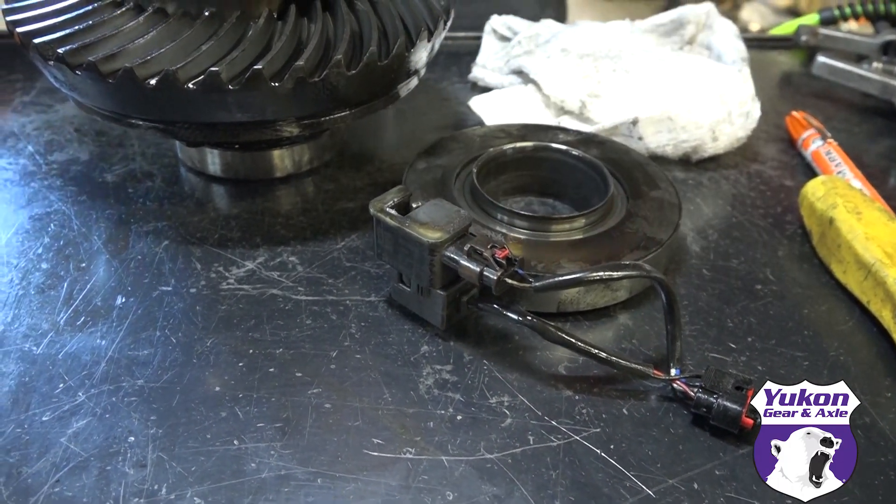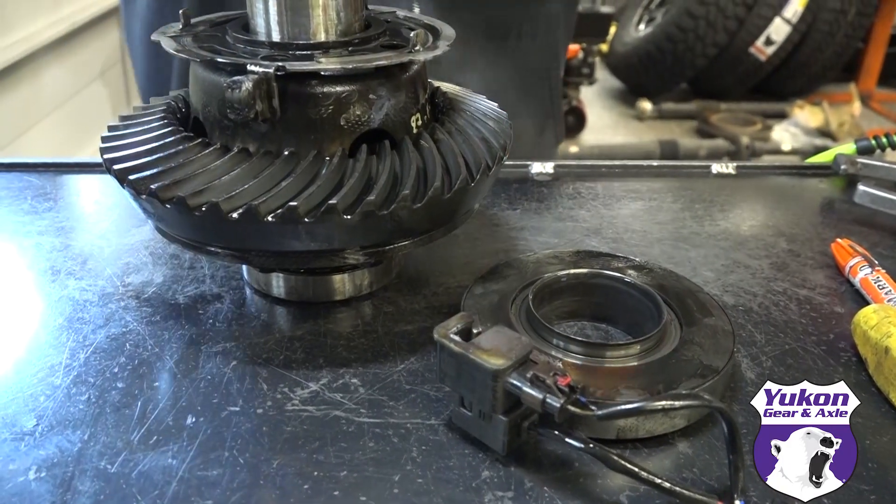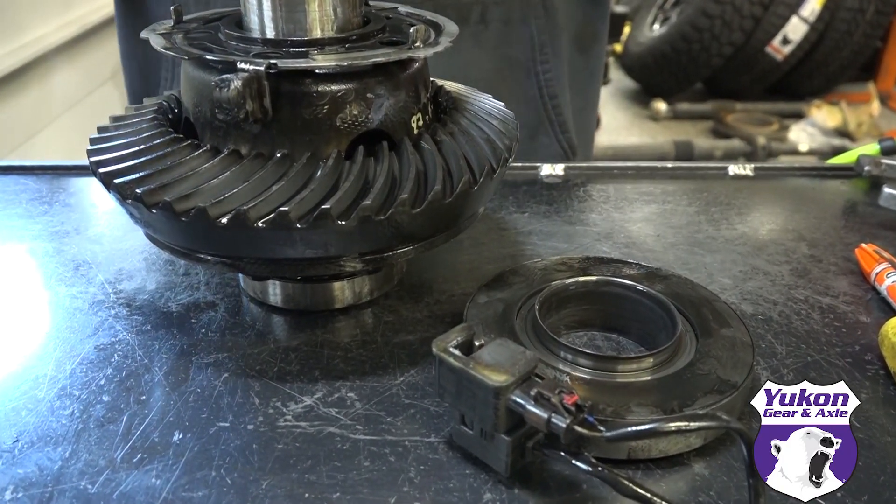By bypassing this arrangement and going straight to your switches or your S-Pod, I think that's a much better way to go. A couple of advantages: I'm now able to lock my front differential independently of my rear, which I do quite a bit. I actually use the front more than the rear, especially in the wintertime in the snow — a lot of times you don't want the rear lock because it will cause the vehicle not to handle properly on ice and snow. It kind of gives the illusion of a front-wheel drive car. I'm a thousand percent happier with my Gladiator having my lockers controlled by my S-Pod, and we'll do a video soon to show how I did that.